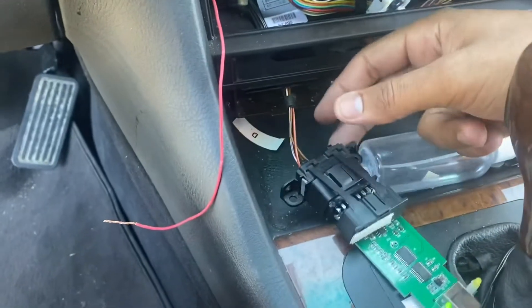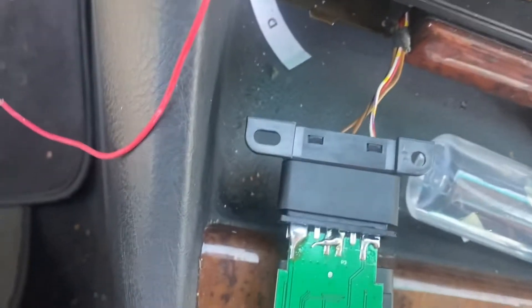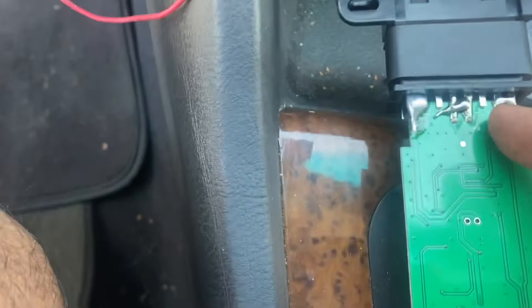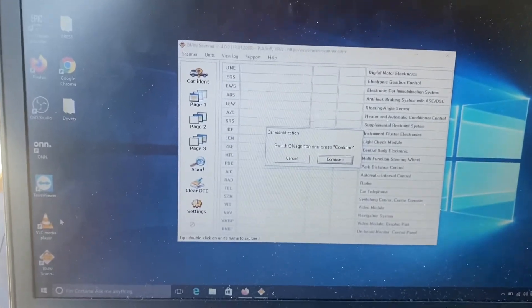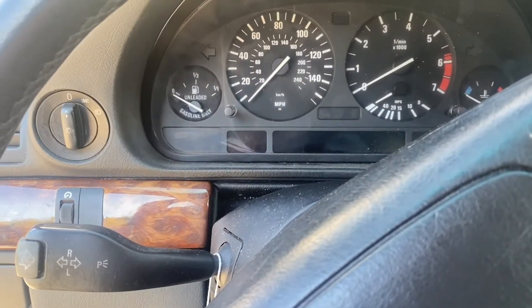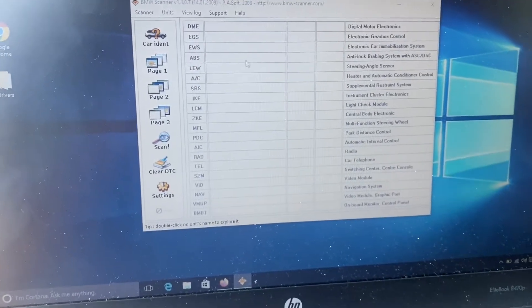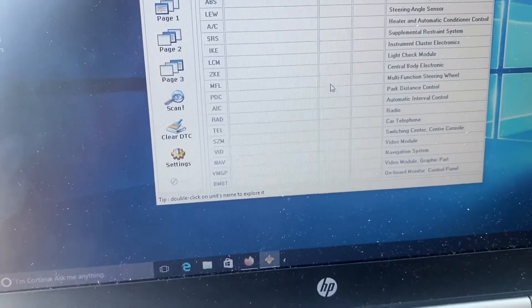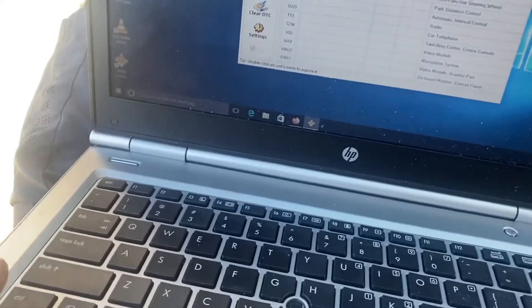So I just pulled out the OBD2, I did not add anything else — just connected my scanner. It already comes with pin number 7 and 8 soldered. If this is how it comes in, it's not going to pick it up. I fired up the BMW scanner software, turned the ignition to key position 2, and you're going to see it fail — hardware not ready. If you try to scan, it's going to say hardware not ready. But there's a way around it.